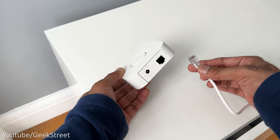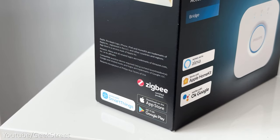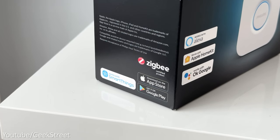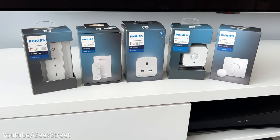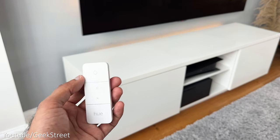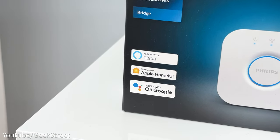Finally, connect up the Philips Hue bridge by plugging in the ethernet cable — the other end goes into your router — then plug in the DC power. The bridge uses Zigbee technology to communicate with lights and accessories, with a longer range than Wi-Fi. You can add devices up to 25 meters away accounting for walls and furniture, add up to 50 lights and 10 accessories, control devices remotely, and link it to Amazon or Google voice control.